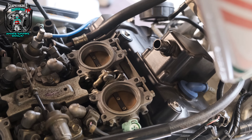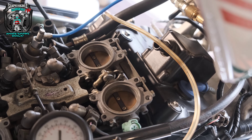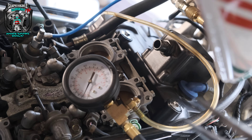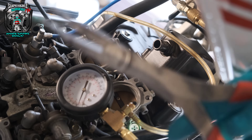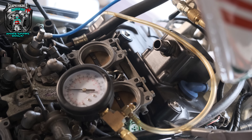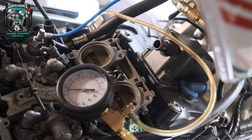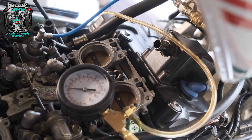There's another test you can do. If you get a pair of pliers and the fuel line is rubber, you can pinch this fuel line with your pliers. When it primes like this — see, I get extra pressure. That way you can see the maximum pressure the pump is capable of making — in this case close to 70 psi, which I think is low for one of these. But I'm just showing that test because it's kind of interesting.